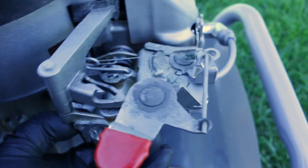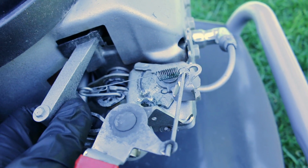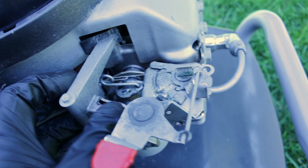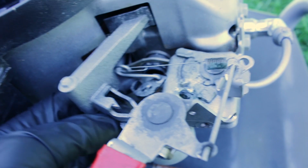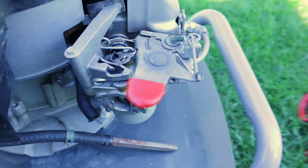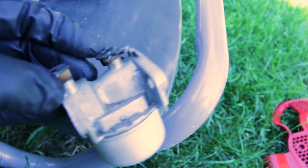Okay, top cover's out of the way, 2 bolts out of the carburetor. Now we just have to get the choke linkage and the throttle linkage unhooked without bastardizing things. It looks like the governor is easiest to maybe just pull that bolt, and then the choke plate, I'm not sure yet. We might be able to spin the carb around to get it unhooked after that. Should be no problem. And that did it. Just taking that out. Now I can spin the carb enough to unhook the choke linkage right here, and then our carb will be free. And just like that, there we go. Now we can work on the bench.